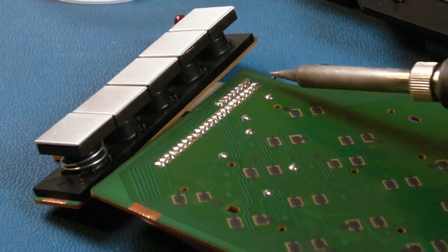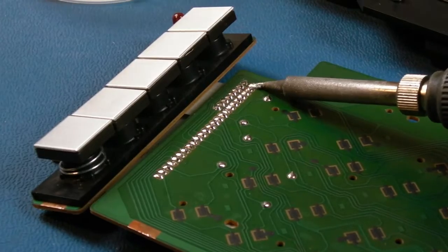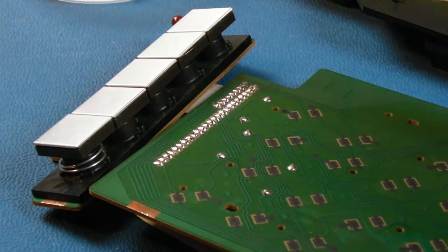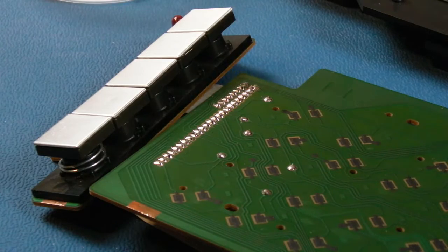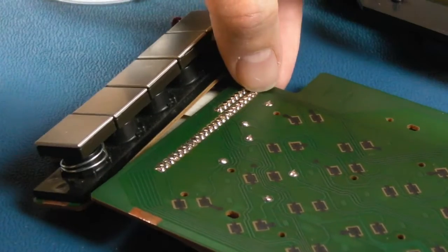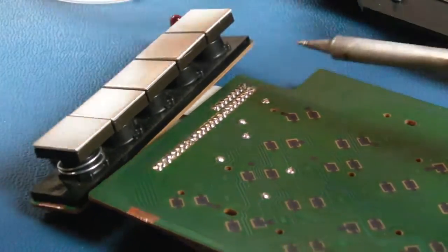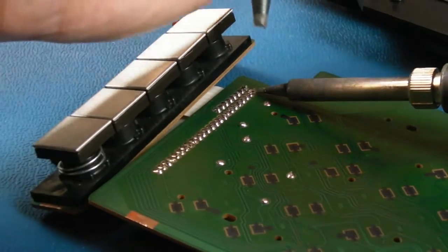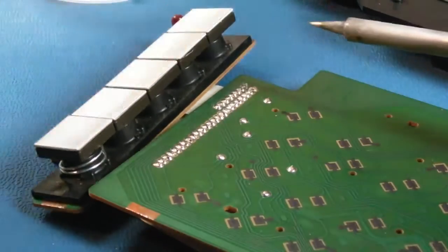Yeah, so I'm simply going to desolder these two bits of wire here, as I say. There we go, that's come out with the solder plug. It's such a fine wire anyway, there might still be a bit of it there. Yeah, it's still snapped on the edge, I think, maybe. Yeah, we'll give it another go. Hang on. I'm not heating too long here because it's single-sided.